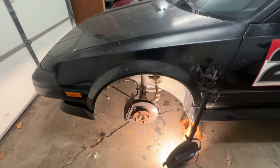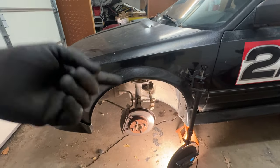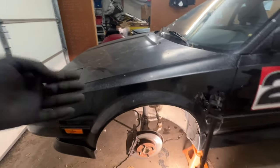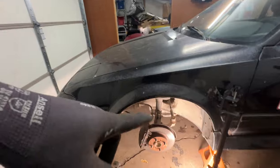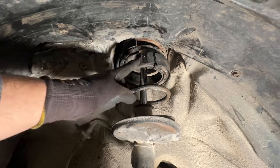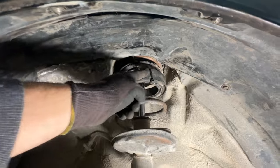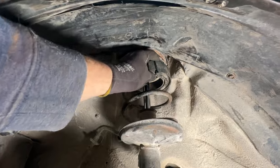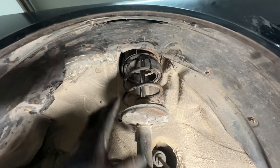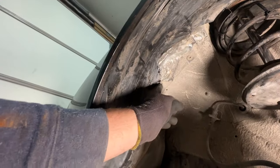The wheels are off here. I've already used my expert skills to install adjustable suspension in the front. The way you adjust it is you get these rubber spring spacers and you put them in there, and bam! You've added three-quarters of an inch of height — not travel, just height. What we're trying to do is keep this rubbing down.